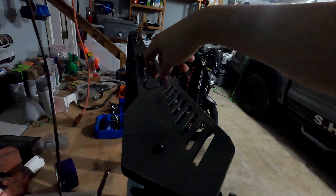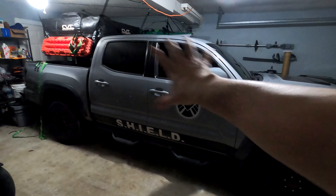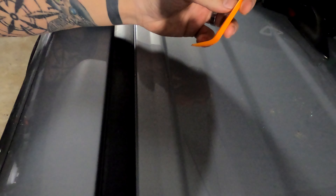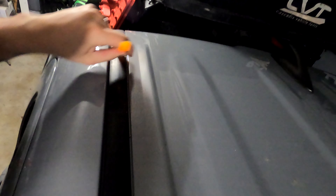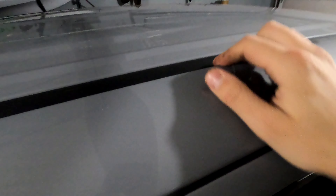I'm going to continue with the handle install portion. I don't have the full handles yet, but I can get these plates added on. The grab handle kit has a bunch of spacers and bolts with 5mm hex ends. You run the bolt through the handle attachment, then a spacer, through the Armor Tech, then a second spacer, and it screws into the Groove Tech. I'll repeat that for all four grab handle locations.